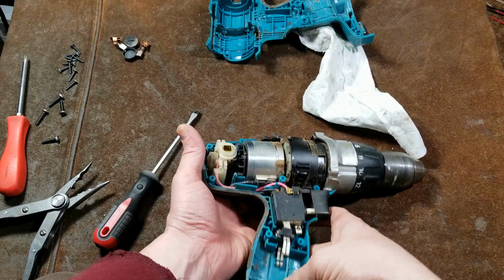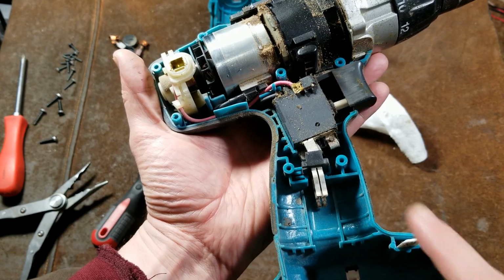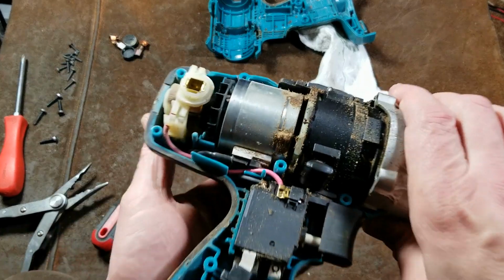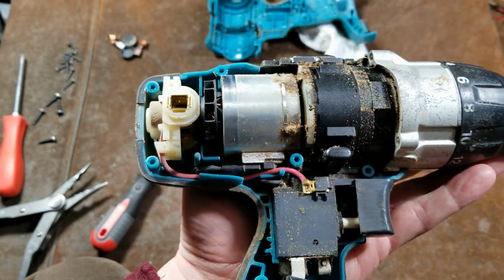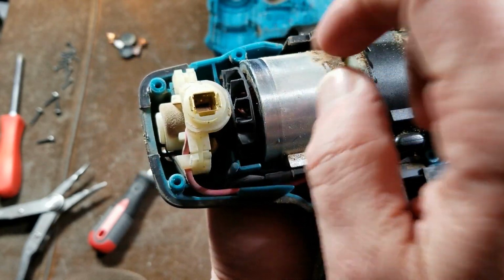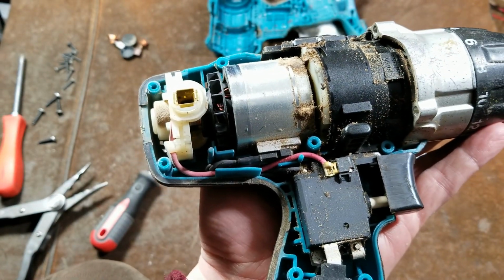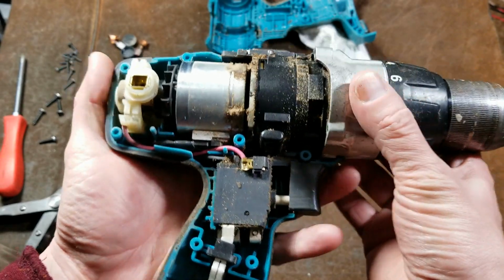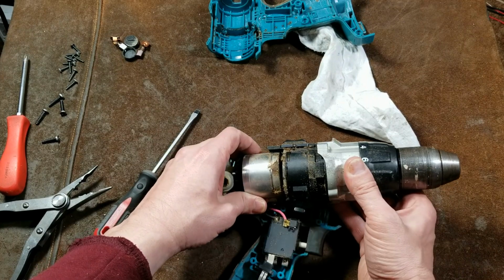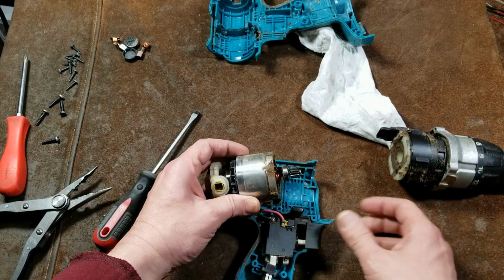And no brushless here, just a simple chopper circuit. It's all integrated into the trigger. So I need to get this open so I could solder the wires properly. There's just a huge gearbox in there, and there's our big D31 motor. The little chopper circuit is screwed to the housing of the permanent magnets, acting as a big heat sink. So that's pretty wise, and we'll just get this gearbox apart here. First, we'll show inside the motor. There's our gearbox. Definitely a little bit dirty.